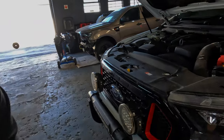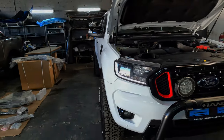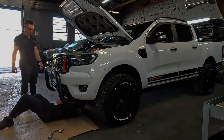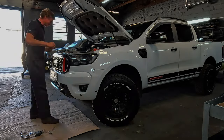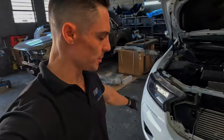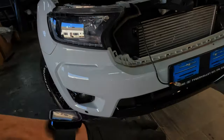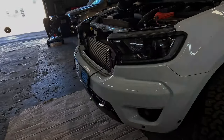First step - putting the front bumper on means taking off all the original parts. We're going to start with taking off the cover for the grille, the nudge bar, the bumper, and get everything stripped, then start with the assembly on the bumper. We've got the grille out, took some of the park sensors out to paint them black since the steel bumper is black and we obviously don't want white park sensors in a black bumper.